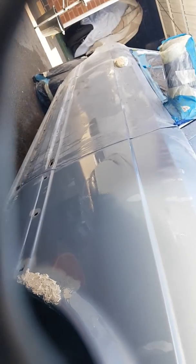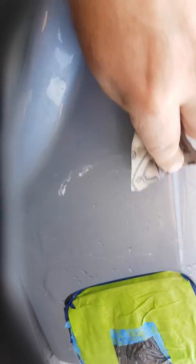And the one thing I've had with the car right around is this line. So some oik before me thought it'd be a great idea to repair the car with every intention, but what's taking me ages to sort out is the mistakes made, and one of the mistakes is this line that they've left. So now I've been very gentle with this. If I go anything more aggressive than 600, it'll take it down to the steel, and I don't want to do that.